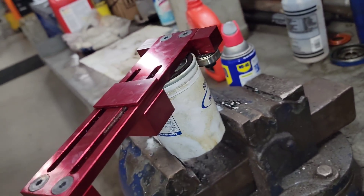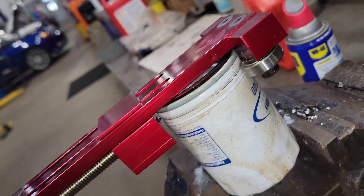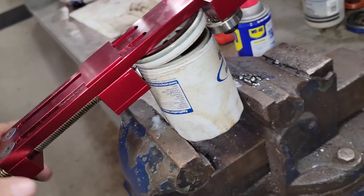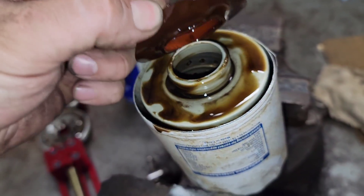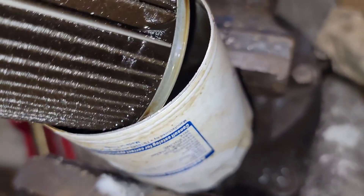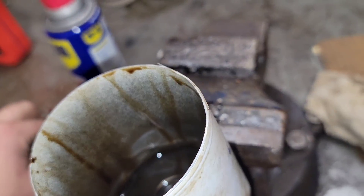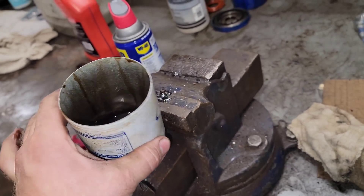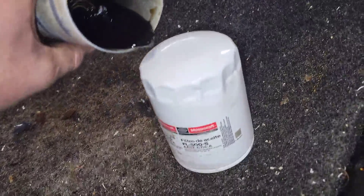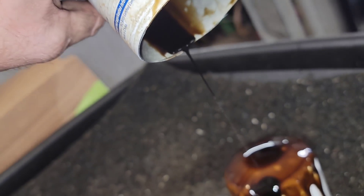This is the original filter that was on the vehicle — it's a Pronto, typically done by a quick lube service place. I'm cutting it open so you can see. The top's coming off and it is just extremely nasty inside — chunks of carbon and metal and all kinds of stuff in there. We don't even know if we can save the motor, but the customer wants to try with the least amount of money possible. There's a plastic material down in the bottom — we have no idea where it's coming from. It's almost like paper bag-type material.